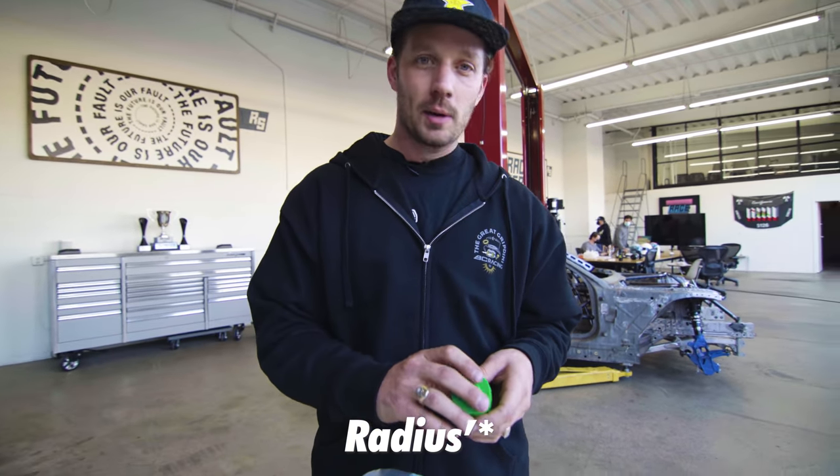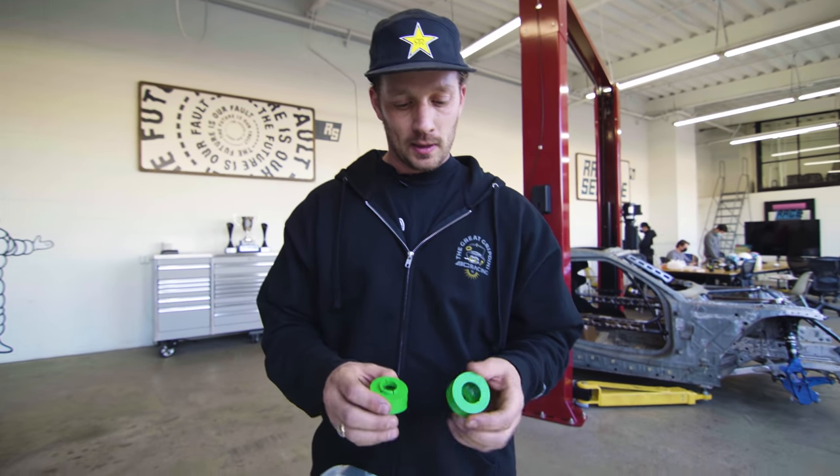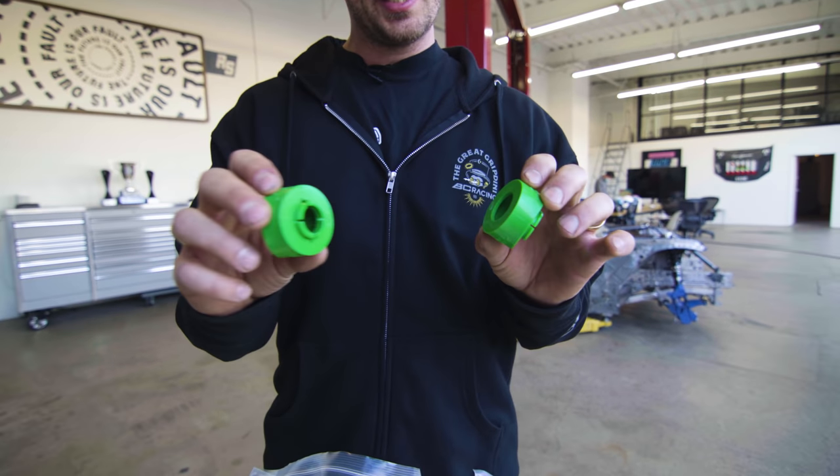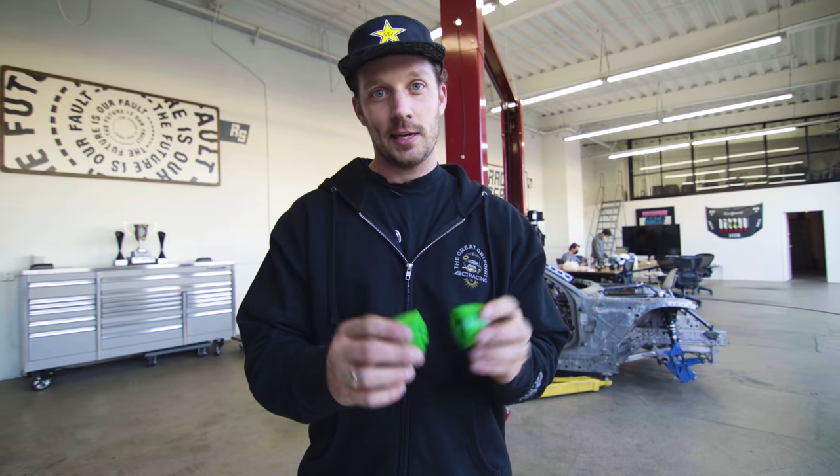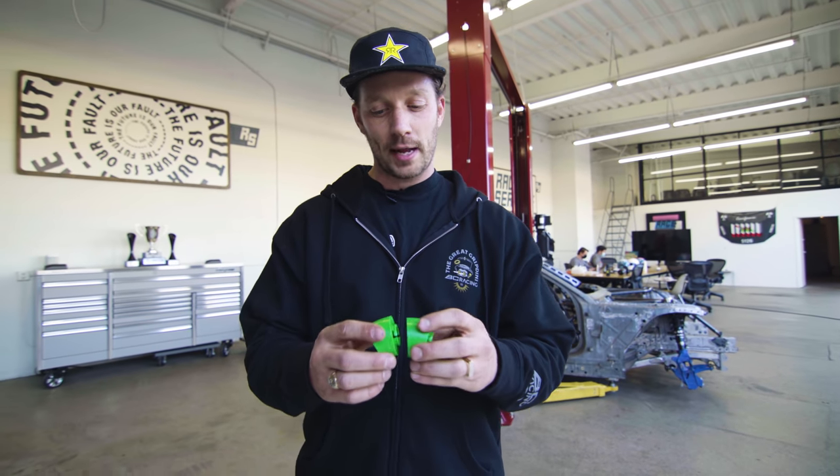So we are gonna be running a 2-inch OD Inconel tube. Here we have the 1 7/8, but we need a 2.5-inch center line, and they only make the 2.5-inch center line in the 1 7/8 blocks, so that's perfectly fine. That's what we're gonna use.